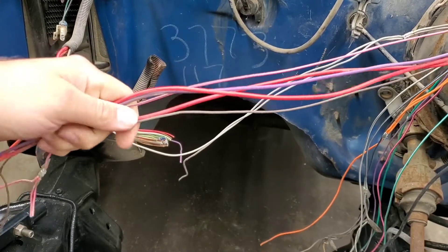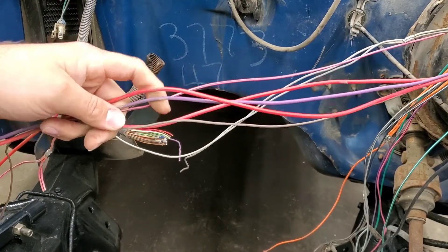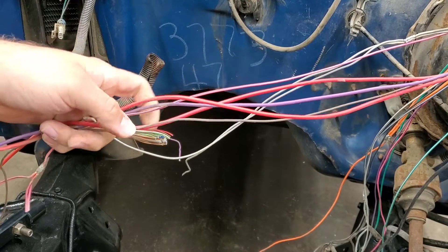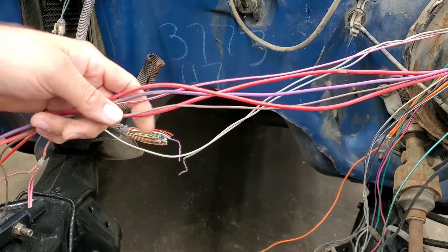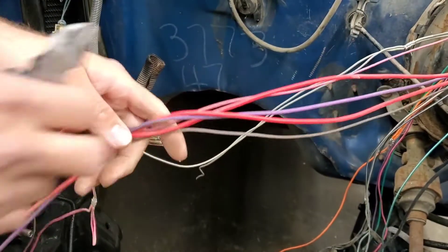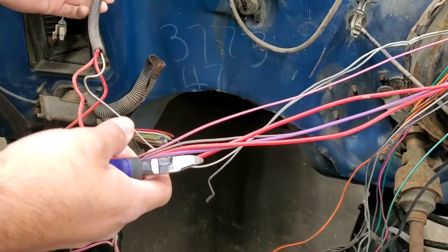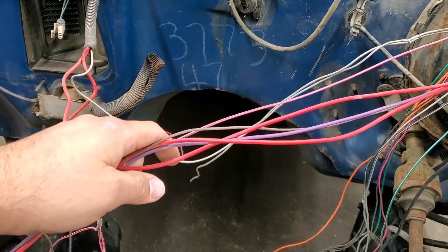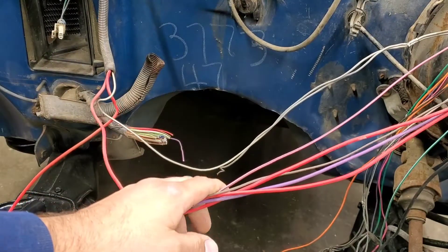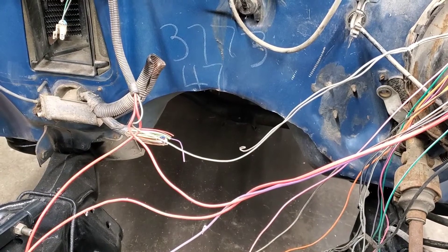As you can see, we've got the pink reddish wires — purple starter wire, pink and red for the alternator. Brown wire and pink wire with the brown stripe for the battery light in the dash and the alternator plug. There's one more wire I can't quite remember what it goes to, so I'm not going to clip it off the rest of the way yet — I may just pull it through. I'm going to replace this loom anyway and clean it up after we get the firewall painted. We'll move over to the other side and save some of it in case I need it later.